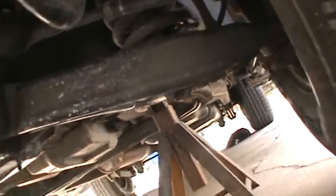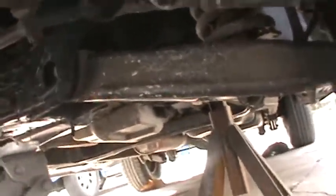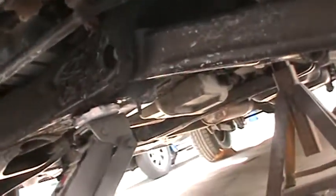Looks like a factory shock, and obviously we have some suspension woes. To check the ball joint, the best way is to jack the vehicle up, support the frame, get your jack stands in a good safe location. I always like to leave the jack under there just in case - locked down. So I got two jack stands and the jack in just-in-case mode. You want to take a long bar or pry bar and look at the ball joint. Put it underneath the tire, pry up, and you can see that ball joint is dangerous.